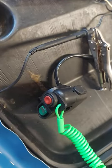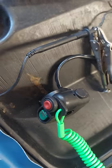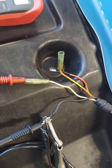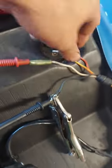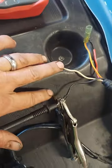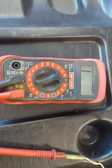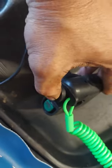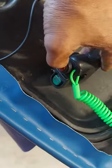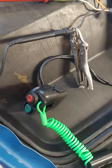I've got a Kawasaki start/stop switch here. The wires coming out of the switch are black and white, and depending on which ski you have, there are two other wires. This is the start circuit, this is the stop. With a voltmeter set to continuity, when I hit the red stop button you can hear the meter — it makes a connection when those two wires come together.